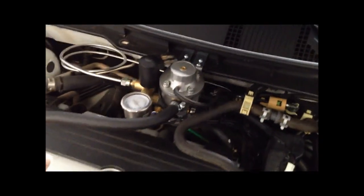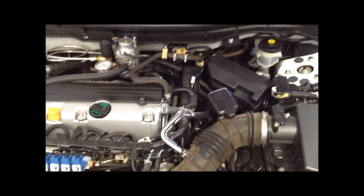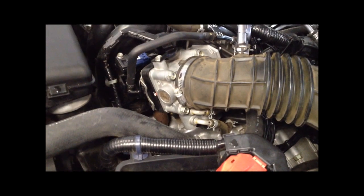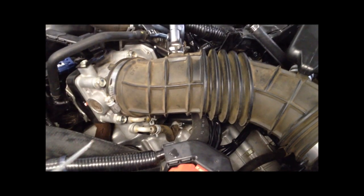On the regulator up here you can also see the coolant lines — a little difficult to see, a little low light here, one on each side. These are typically teed into your heater core coolant lines. In this situation, and in many situations, you'll find that cars have a heated throttle body where they circulate coolant for colder climates to keep the throttle body from freezing over. You can see two lines circulating coolant through this assembly just to keep it warm. Instead of teeing in and cutting into the heater core lines and creating more leak points, we tap into this source.